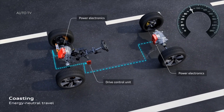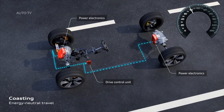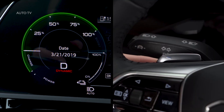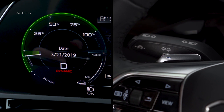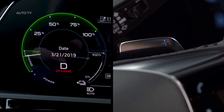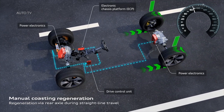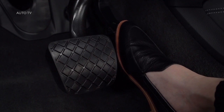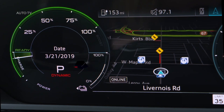The default level is coasting — no regenerative braking will occur unless the brake pedal is applied. Pull the minus paddle once for the first level of braking effect and regeneration, and again for the second level of braking effect and a higher level of regeneration. Pull the plus paddle to reduce the braking effect level. In either regeneration level, the vehicle will decelerate and battery regeneration will begin when the accelerator pedal is released. The power meter needle will go into the charge zone, showing power is flowing to the battery. The charge zone will expand as the battery charge decreases.